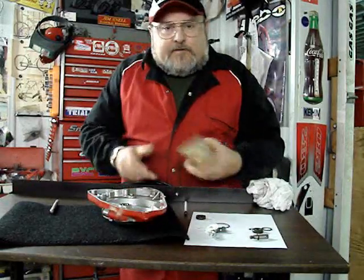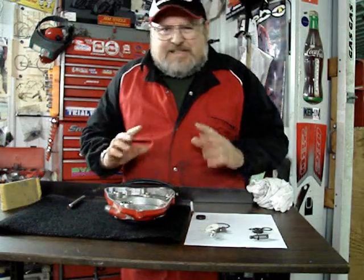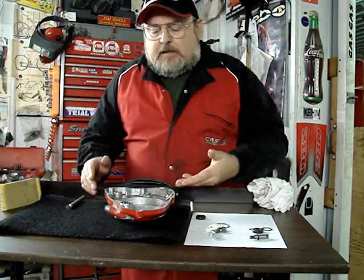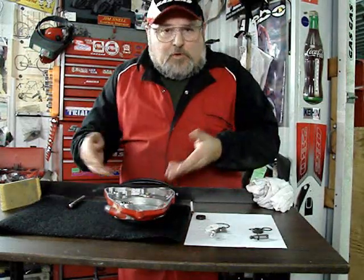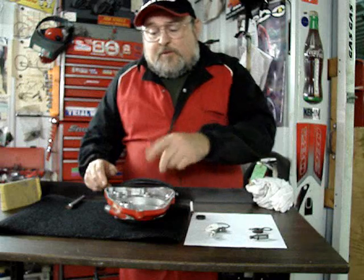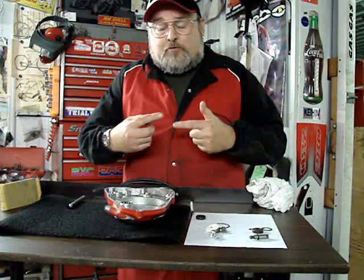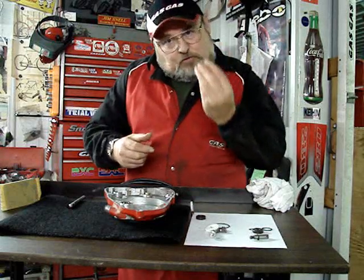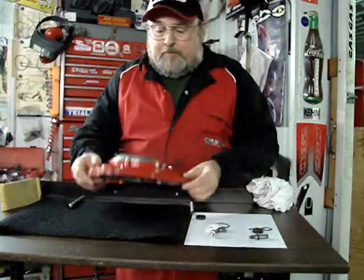The original gaskets from Gas Gas are coated with wax. I do not recommend any type of sealant. When you use a silicone sealant, it ends up being a mess and some squeezes into the inside of the engine. Never use a sealant anywhere near the water pump system because that sealant squeezing into the system can obstruct your radiator and your water pump impeller.